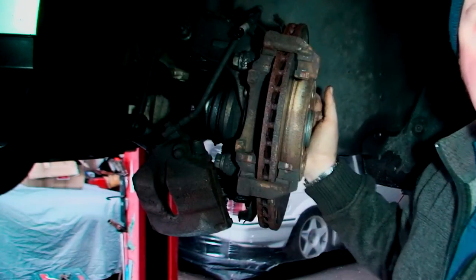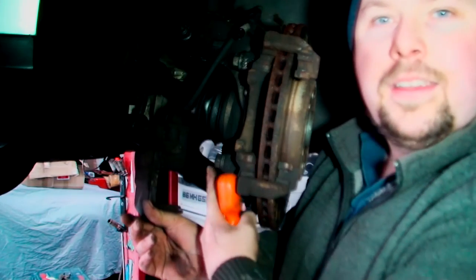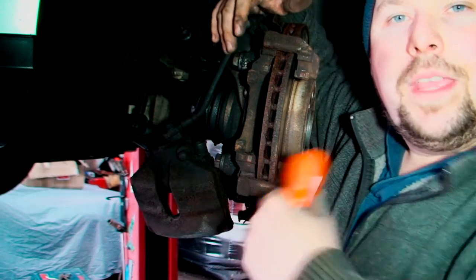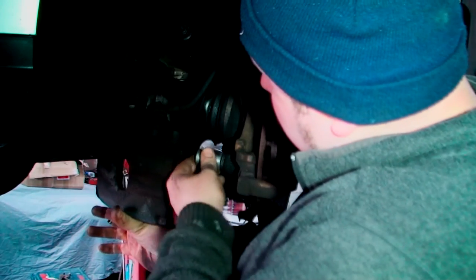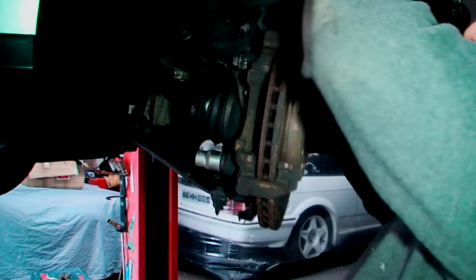I'll get you underneath now to see whether, well, actually, can you see him there? Move my hand. Oh, you can. Big bolt there. Big bolt there. Them two bolts. My hand's out of the way. This bolt here and the bolt there. Once we take them off, the carrier comes off. Sorted. They look like 22s. But anyway, like I said, they're 21s. Don't make mistakes here. Just move that out of the way for the minute.